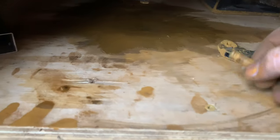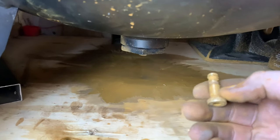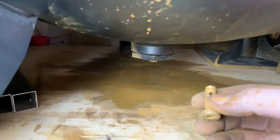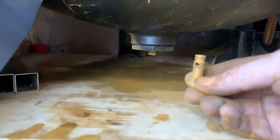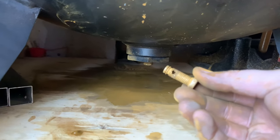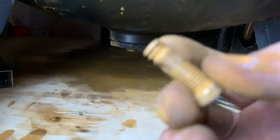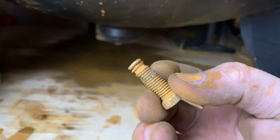And as I fully undid it, this bolt came out at 60 PSI with all the air in this thing, and Jesus, which was just ridiculous. So yeah, pay attention to the thread orientation on these things, and this O-ring is wasted out too, so they got me. Here it is.